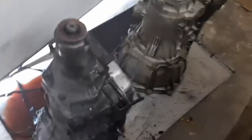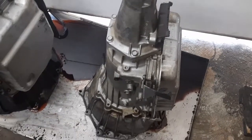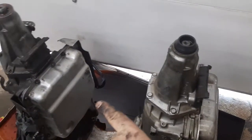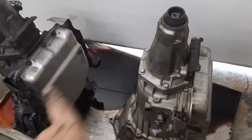So why would you change the transmission out? Why not just get this one rebuilt or just replace the torque converter? Here's a really good example of why — this is the fluid from the bad one, and that's the fluid from the good one. It is nasty. There is no comparison, and there's no doubt in my mind that the original transmission is completely smoked on the inside. Those clutches are probably nasty, and there could be other damage I'm not even aware of. It's about $1,400 to get this one rebuilt plus a new torque converter — those are $200 or $300. This junkyard one was $100 and it was rebuilt six months ago. Yes, I'm still taking a risk, but everything I saw looked good. The vehicle itself was messed up — that's why it was in the junkyard. It wasn't anything mechanical; it was physical damage to the vehicle.